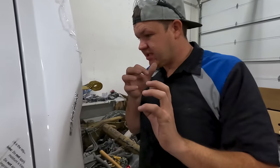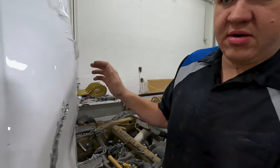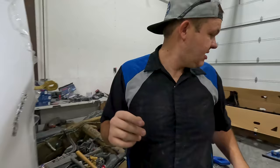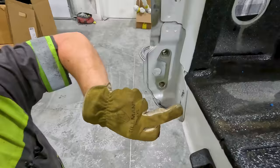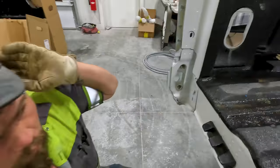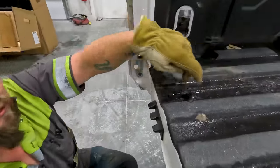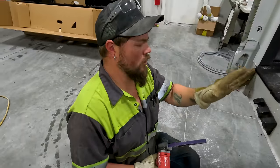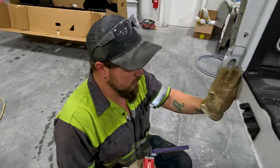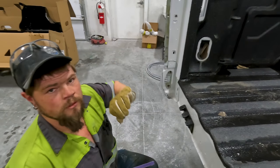Okay, now we've got to set up the bridge puller here. So I'm gonna put a foot somehow here and then across the back. Okay, I looked at the new panel and I have to grind these six spot welds back here, a whole bunch underneath, and then a whole bunch under this bed liner that I'll get removed when I get to that spot. I'm gonna work on top of this piece, the bottom, and there's a bunch across along the front that I have to remove too.